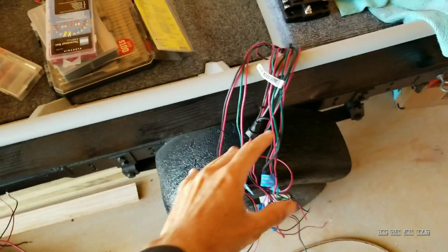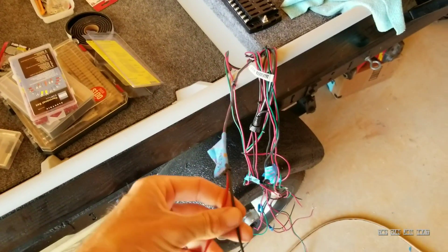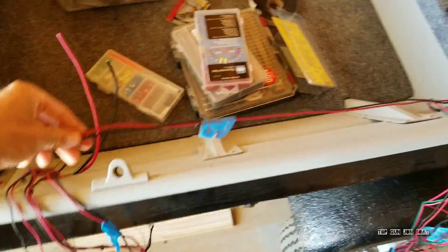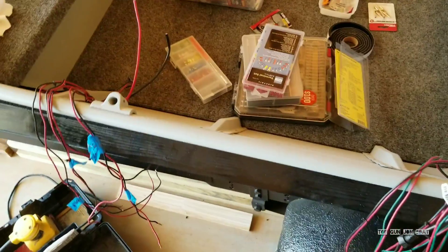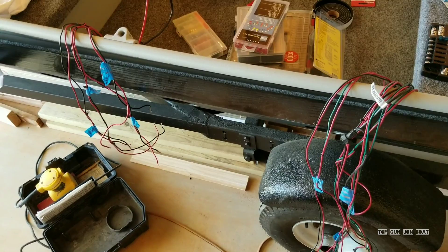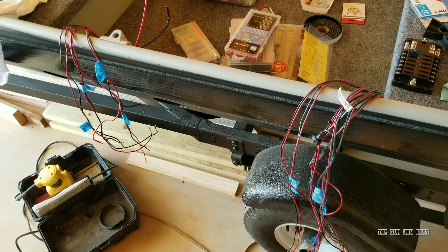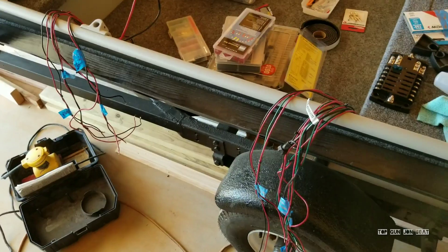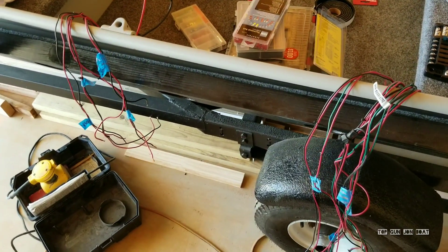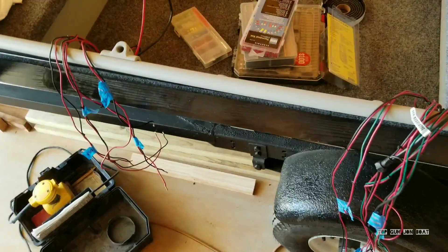I've got everything for the front coming out here and everything for the rear coming out here. I've labeled everything and they're zip-tied together in different feeds so there's no confusion as far as what goes to what, giving myself ample wire to do the final wiring. I want to be transparent with you guys — this is 14-gauge primary wire, not marine-grade wire. At the time I did the wiring, over a year ago, I didn't understand the difference. I'd used primary wire in a lot of automotive applications for cars and trucks, and I went with it without really digging into the difference in copper tinning and how marine-grade wire is actually a different grade.